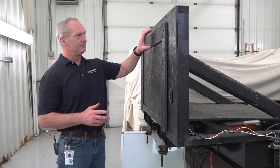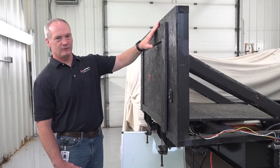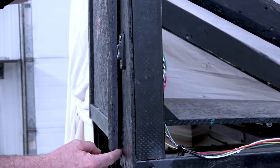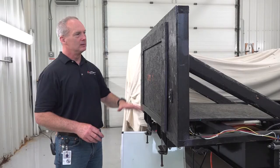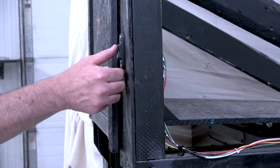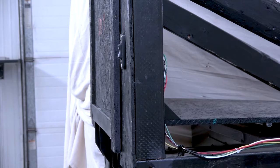When the room comes back in, you'll notice that the top of the room touches the unit first. As you can see, there's a gap at the bottom when I stopped it right as the top touched — that's before the bottom seal actually seals. This is normal and is the adjustment you want to check after adjusting the head assemblies. Once fully retracted, you can see it's sealed all the way along the top and bottom — and that's correct.